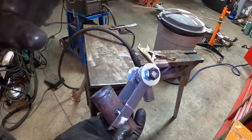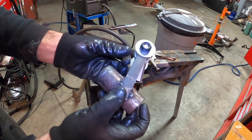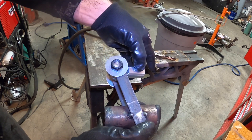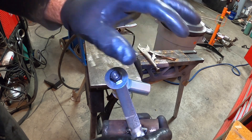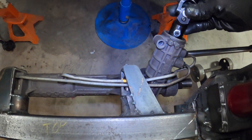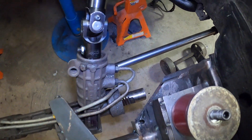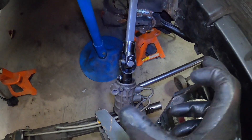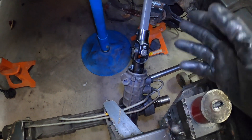Here's our prototype. What remains for final assembly is this piece and this assembly, which will have modified brass bushings to fit inside. The tie rod sticks out and moves in all directions, following the contour of the moving tie rod as well as inward and outward as needed, with no lateral play. Let's center the rack and figure out where center is - once we know that, we'll know exactly how much to trim. Pretty close is good enough for centering since tie rods are adjustable for alignment. I think I'm pretty close, so let's figure out how much to cut before we weld.